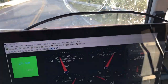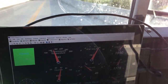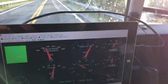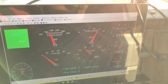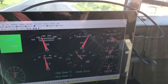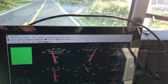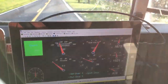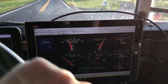Now we're in fourth gear — and notice it never unlocked. It stayed locked up just like it was supposed to. Fourth gear, nice acceleration, it worked exactly like it's supposed to. I let off and kicked into fifth — I've got sixth locked out for now because of my low rear gears. If I kick it down, it downshifts right into fourth gear like it's supposed to. Upshift after I let off — working perfectly. That little exercise solved my issue with the torque converter unlocking when it wasn't supposed to.